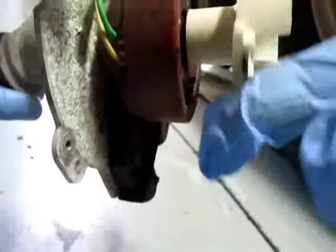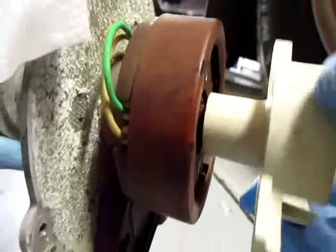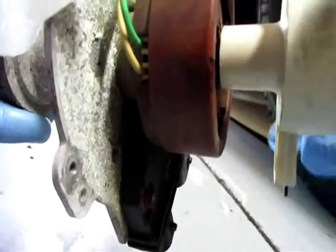In about two seconds I could tell that rebuilding this is going to fix it, because when you turn this rotor the distributor turns terrible - it's all notchy. And I feel very minimum magnetic pulses from this star - it has a couple ones that hit and a couple ones that are dead. So it needs a new shaft which we have. The play is not too bad but it should spin very smooth. We're gonna put a whole new housing on it. This one actually has a part number on it. These get all corroded and nasty - look at all the corrosion. The gear looks good, very good, so we'll use that.